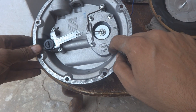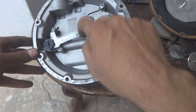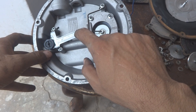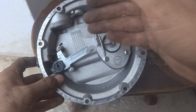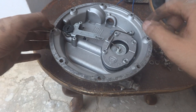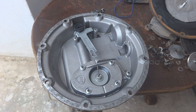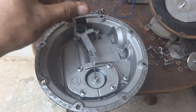Here are a few parts, and here is the very important part which is controlled by this diaphragm — this is the main gas control going to the engine. This part is not very dirty, it's clean, but oil was there in this cavity and the intake side. So we will remove these parts and clean inside so that everything will be in perfect order. We are going to remove the two screws using the Phillips screwdriver.